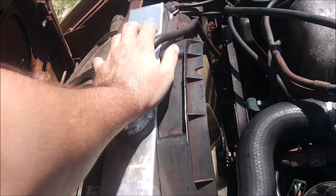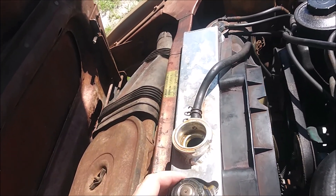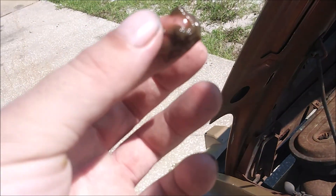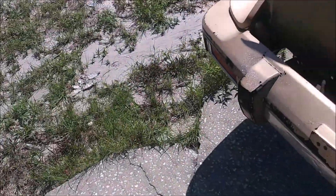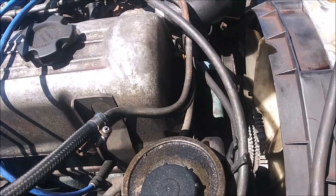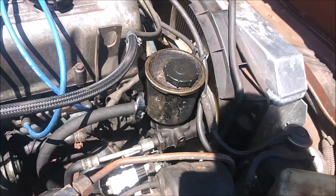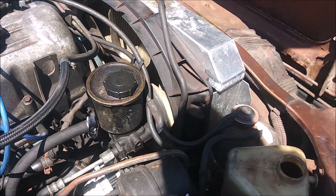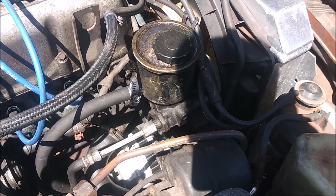The fluid in here is kind of nasty looking because it's the Thermocure — it's supposed to look like this when it's doing its job. That's not good looking at all. Obviously there's a problem, and we lost a lot of coolant. Let me pull this dipstick out real quick — dirty but it's not milky, so I don't know where the water went.